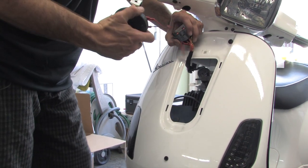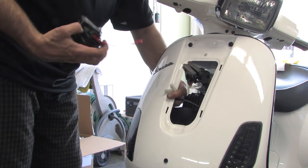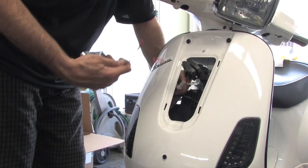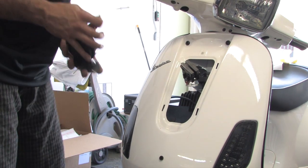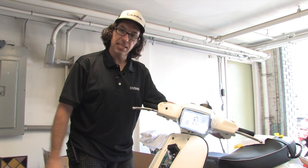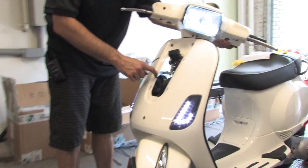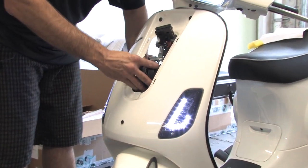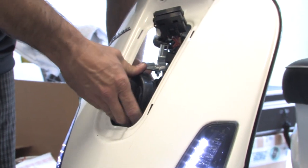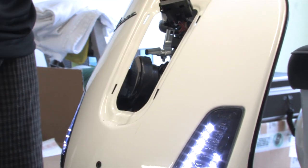I'm going to pop this in and hook up the two electrical connections. Normally I'd use two male quarter-inch quick connects — these are just spliced, it's all I have on the spot. The horn is installed — I'm going to honk it and it's going to sound like the sick duck noise, and the reason is the horn is making physical contact. You just need a little tweak of the bracket to get it where it doesn't make physical contact with the frame.